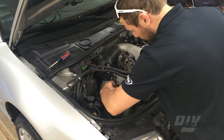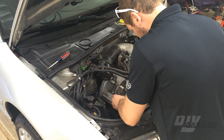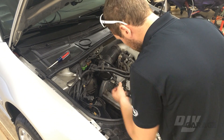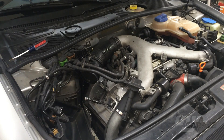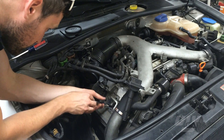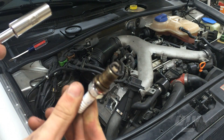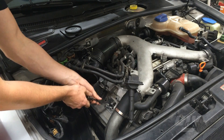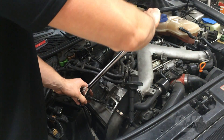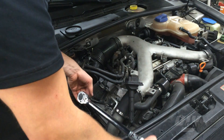Now we can get a 10 millimeter socket to remove the bolts on the second cylinder ignition coil. When the bolts are removed, the coil will simply pop off the top of the spark plug. We can now get the coil out of the way and with a 16 millimeter deep socket and extension, the plug can be removed. I removed the plug first to see if there were any obvious indications that the plug was bad. It didn't look like that was the case, so I reinstalled the plug. Make sure every time you reinstall the plugs, you tighten the plug with a torque wrench since the plug threads into aluminum. The correct torque spec for this car can be found in the description.